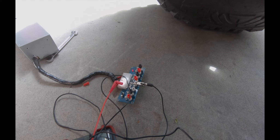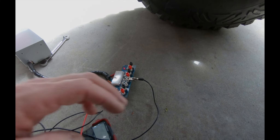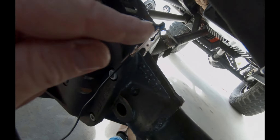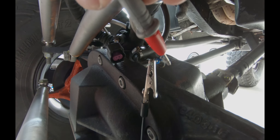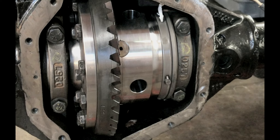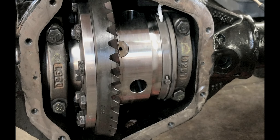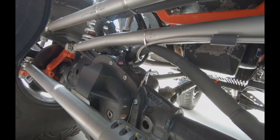It's a great tool because I don't have to rely on the vehicle's electrical system. If I have any concerns that I've got issues with my battery delivering current, I can deliver current with this guy, knowing that I've isolated the problem away from the battery. If it works with this but it doesn't work with the battery, that's another piece in the puzzle. So I connected my ground right here — you'll see my ground wire connected up to one of the terminals. Now I'm just going to try and energize this one. You hear that click? That's the locker engaging. So what that tells me is it's working — it's just not getting continuity.